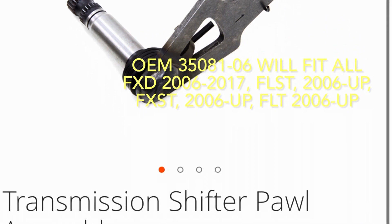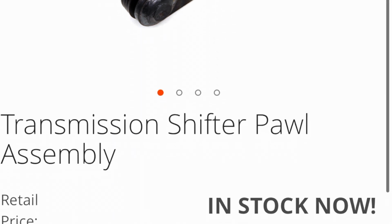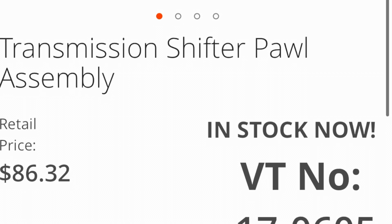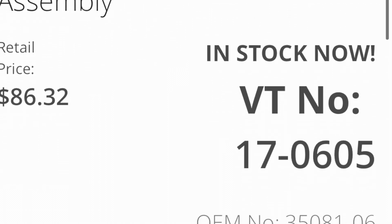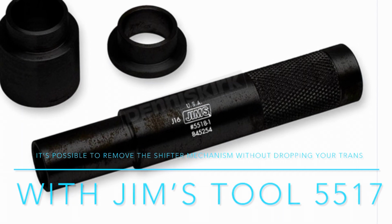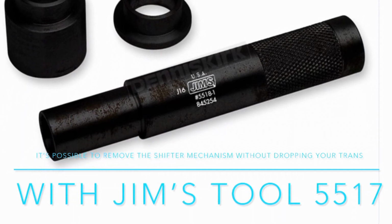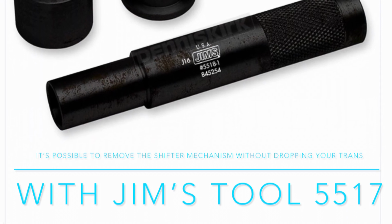The rear shifter mechanism is definitely a failure point too. Also make sure it operates smoothly and correctly through all the gears and the splines are in working order. If you're going to replace it, you'll need a trans top cover gasket, full primary gasket kit including the inner primary seal, also known as the primary crankcase seal. And replacing this one is quite more extensive than the others. If you weren't looking to drop the transmission for a Baker, you can use Jim's tool number 5517 to get the mechanism out without having to drop the trans.